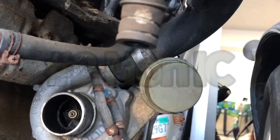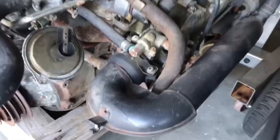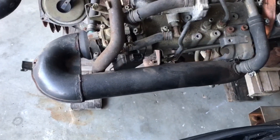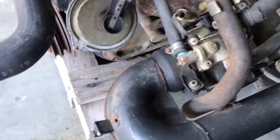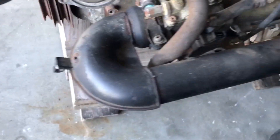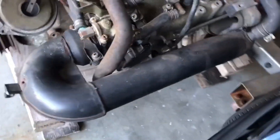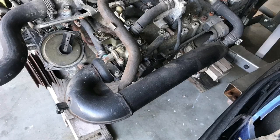Number two is no intercooler. On the 280ZX Turbo motor, the L28ET, the turbo basically discharged into an elbow and then right into the throttle body — no intercooler, no front-mounted air-to-air, no air-to-water, which would become common later on in Nissan's subsequent motors. Having no intercooler is part of the reason they combined it with very low compression. No intercooler and low compression kind of go together to help eliminate detonation.